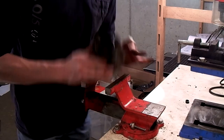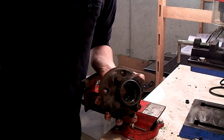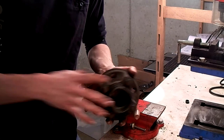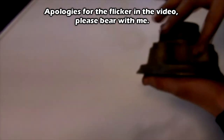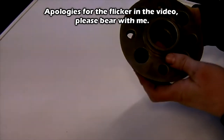So now the hub is completely stripped. I'm going to remove all the studs, wire brush it a little bit, and then put it in a bucket with vinegar to let it soak for a couple of days. These are the front hubs after they've been cleaned. There's a little bit of flash rust but I'll just clean that off before I paint these.